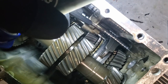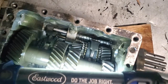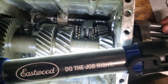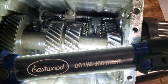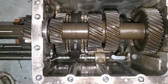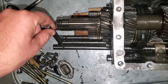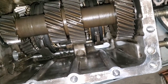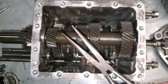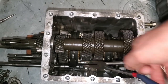Next we're going to remove that clip off of that fifth-reverse shift lever. A good trick I used to relieve pressure off the spring was to push this shift fork forward - that relieves pressure off the spring and should make that C-clip come off a little bit easier. I found the easiest way to do it is to stick a metal rod about the same diameter as the shaft hole in to control it, then with a pair of long needle nose pliers in the other hand you can slip it off while holding it in position with a punch.